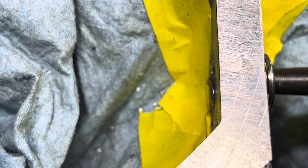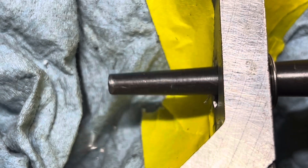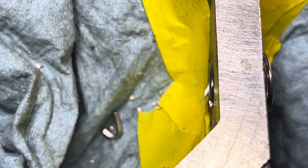Normally when you're done with these coils you stick a punch in here and this lip pops off, because this lip is only here to grab the tool so you can thread it in. They cut this a little right here as a relief — see that little cut mark. Now we're going to take a punch and tap out that end piece. There it is. You can see we did go a little too far with the coil — I'll have to cut that with a cutoff wheel.